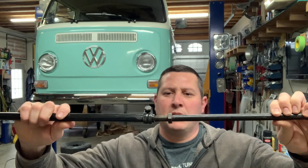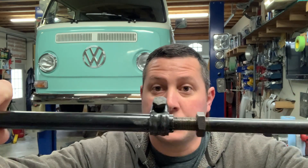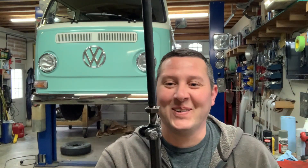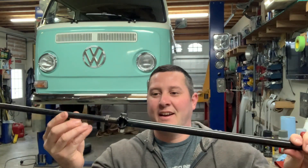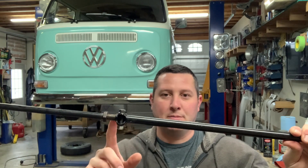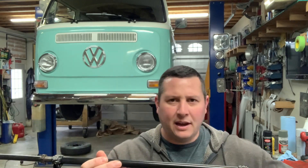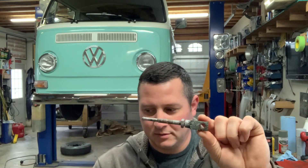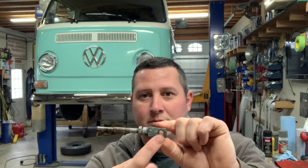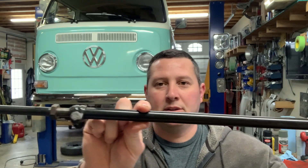I thought, well, they're about the same diameter — and in fact they actually are the right thread. So I started thinking it would look a lot cleaner if I had my old tie rod end. Since it's the same thread I could just cut the threaded end of the tie rod end off and screw it in. Then I started looking around — the manual brake setup has this little piece for the hook to your pedal. All I need is just a little piece right here, and magically I get way longer than I need and it's going to look nice.